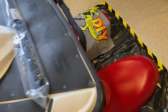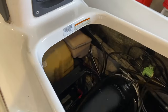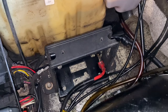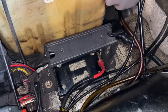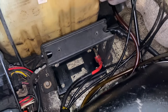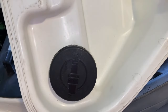Seats are removed. Coming to the jet ski, inside the front portion of the hull is where our battery is. At this point it is extremely important to cut all electrical power to your system. Our battery is completely removed, but in your case your battery is probably still installed — we recommend disconnecting the black negative cable from your battery, cutting all electrical power to the system.